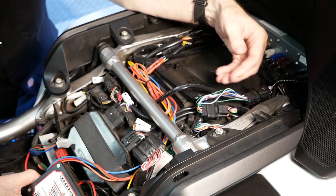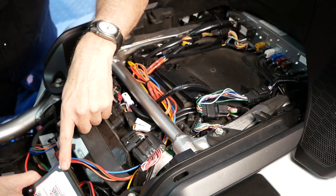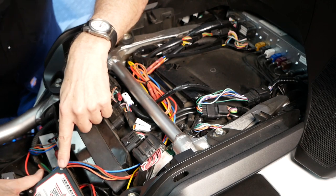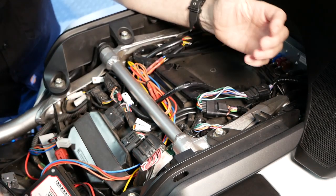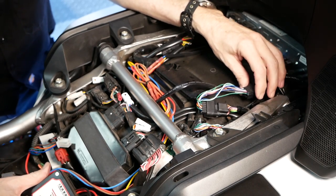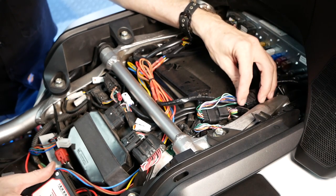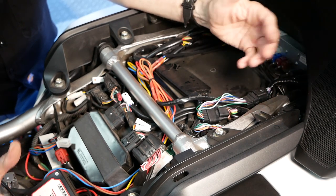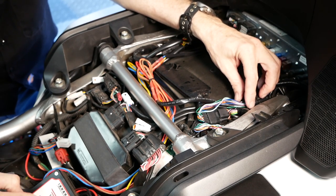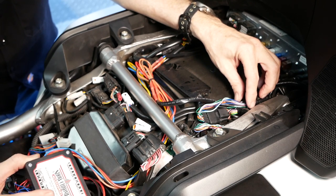The only thing your CAN bus system is operating is the relay. So when you hit your brakes or your turn signal, that wire simply trips a relay in here, which takes very, very little amperage and is not noticeable to the Goldwing CAN bus system. The problem with not doing something like this isolator fuse block is that if you attach a lot of accessories into the CAN bus system and it draws a lot of different amperage, it can actually throw an error and cause problems with your electrical system.